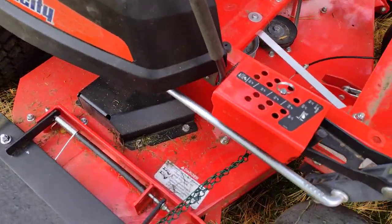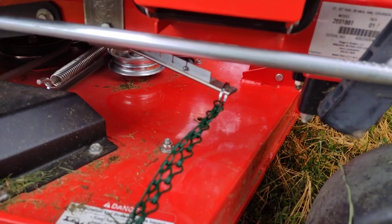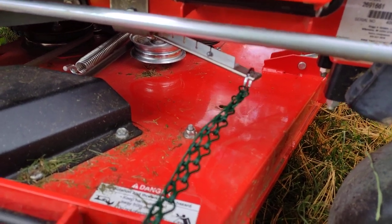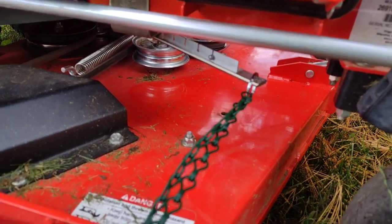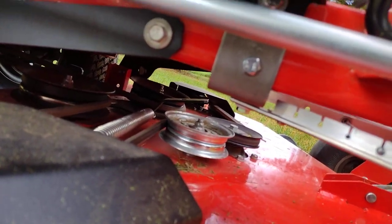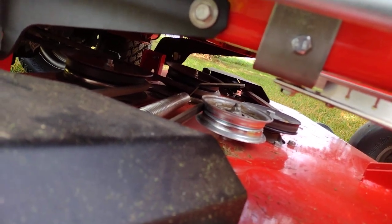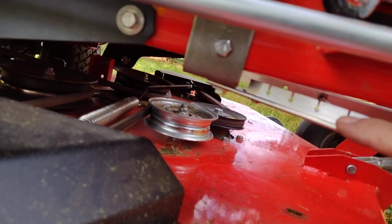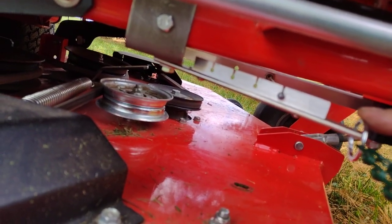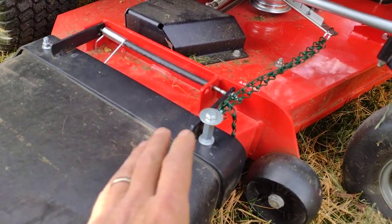Now we get into the funny business. Since I didn't think I could get enough throw out of the foot pedal, I needed to make four inches of foot pedal throw equal five or six inches of throw right here. That's why we have what you can see under here — this arm. It just bolts up to existing holes, bolts up to this piece of steel I cut here. So when you step on the pedal, it pulls from this point to the chute, pulls from this point further away. Four inches of movement on the pedal will create about six inches of movement at the chute.